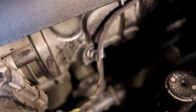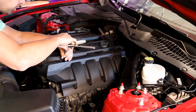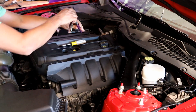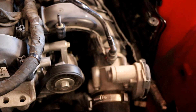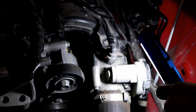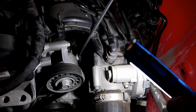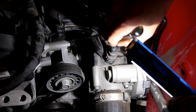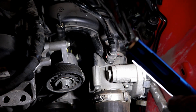I'm going to have to remove it from the other end, which we will do here shortly. For the engine cover itself, it is a 10-millimeter nut as well as an 8-millimeter, and the two of them happen to be catty-cornered from each other. When I say the dirty side of the positive crankcase ventilation, I mean the side that comes from the oil pan. This tube right here — this is what the quick disconnect looks like from the top. This basically takes that oil-borne pressurized air and sends it back into the intake runner.